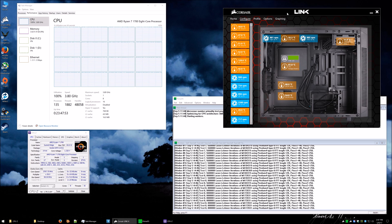Each little step up in clock speed requires fighting a lot harder for diminishing gains. You won't get much more real-world speed going from 3.8 to 3.9 or 3.9 to 4 GHz, but you'll need a lot more voltage, more cooling, and more power. Ryzen seems to top out at around 4.1 GHz, after which the power demand makes it simply not worth it. Overall I'd suggest sticking with 3.7 or 3.8 GHz. Anyway guys, that's another look at the Ryzen system — sorry for the earlier video, and hopefully this gives a better overview. Please leave any comments or suggestions below, take care and have fun out there.